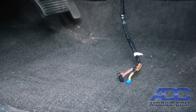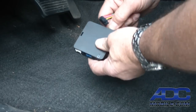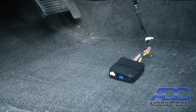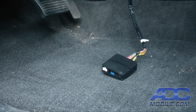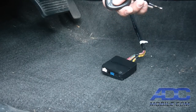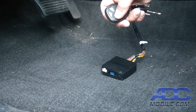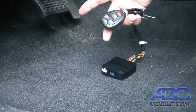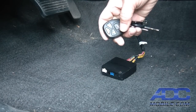Now that programming is complete, we bring the module back to the truck, plug in the blue plug, plug in the black plug, and let the green light show up — there we go, it now recognizes the data bus. Everything's good. We'll do our remote start — the trigger is three presses of the lock button. One, two, three — there we go, we've got remote start and just started the truck. We can do the same thing to stop it: one, two, three presses, and it'll stop.